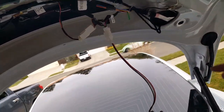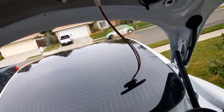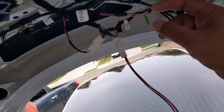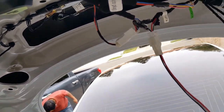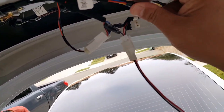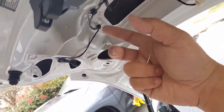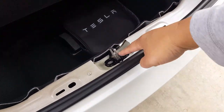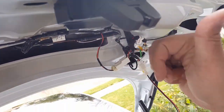So yeah, all these wires are cleaned up. I want to give a shout out to Hansshow. His name is Jane, J-I-A-N. He's the one that helped me troubleshoot. He asked, are you sure your wires are good? Because they were about to send me a new wire replacement and everything. And then Jane said, let's try something else, because I think your trouble is that this latch wouldn't do its part. As a gatekeeper, it wouldn't open up for the trunk to automatically lift. The shock did its part, this did its part, but the one that didn't do its part was this guy here that didn't allow it to unlock itself and pop open.